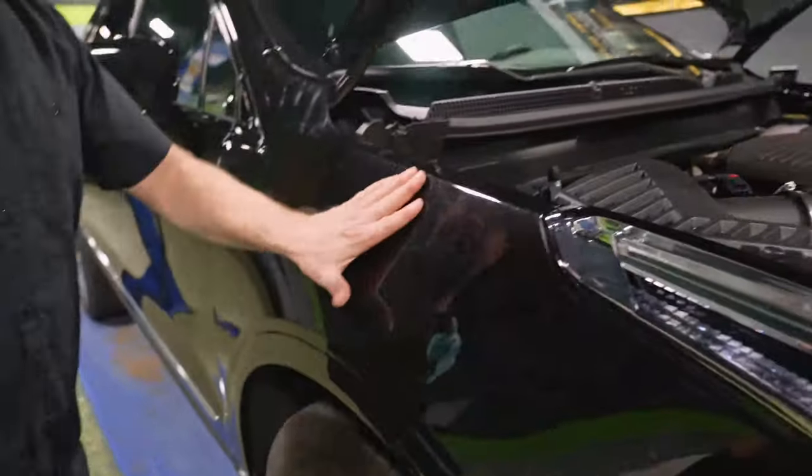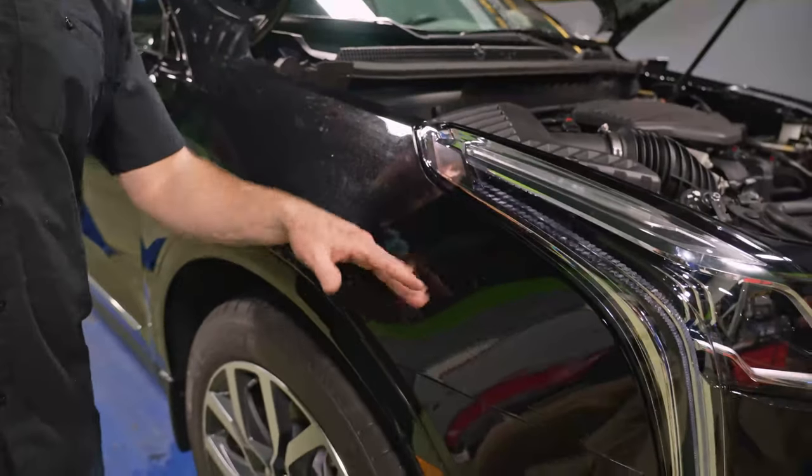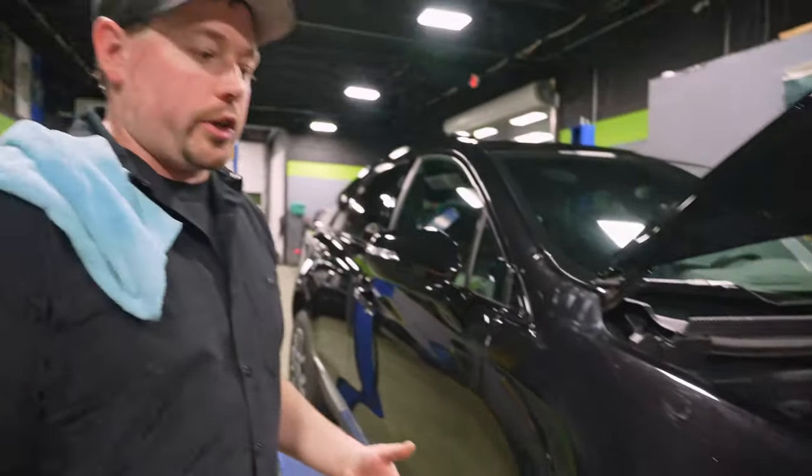Now, let's go check out Aaron's. Isaiah brought up a good point. Some of the silvering basically said, hey, why does this happen? And it can happen for a variety of reasons, but a lot of it's what we call pre-tack. So it's possible that he didn't have enough slip solution in his bottle. How much soap did you put in your bottle? I didn't even measure. I just looked at something and hoping it was enough.